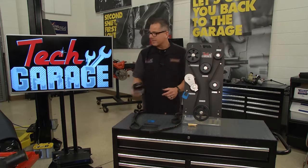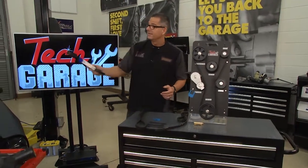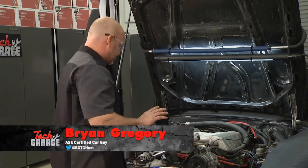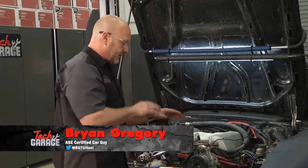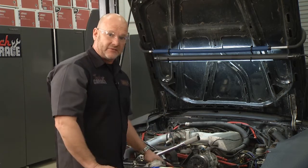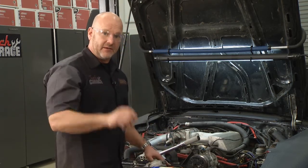All that's left, Brian, is you got to take our belt, which is EPDM material, and put it on that car. Awesome, thanks. I've got the new tensioner on. I've got it torqued. We're all set to go. We'll route that new belt in, install the battery tray, reinstall the battery. I got to tell you, I'm looking forward to the test drive, and I think all we've got left is the email question of the week.